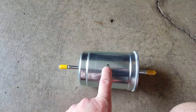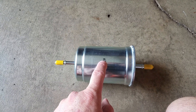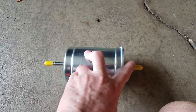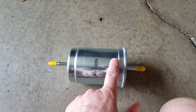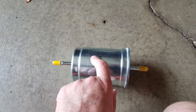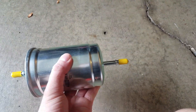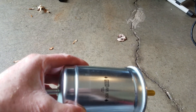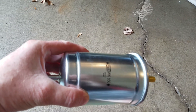I'm going to show you where it's located. If you look at any fuel filter, you're going to see an arrow on it. This indicates the direction that the fuel travels — from the tank on this end toward the engine on this end. This is the fuel flow direction for this filter. Don't get it backwards. Some of these can have an anti-reverse mechanism so that fuel can't drain back, and if you get them backwards, no fuel will go through.